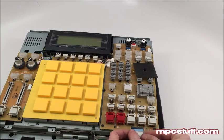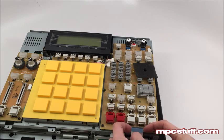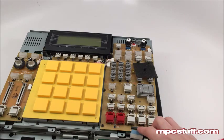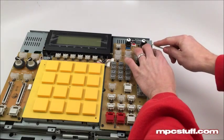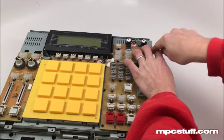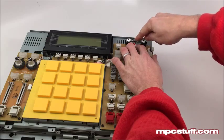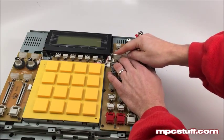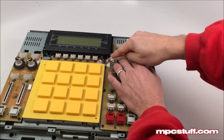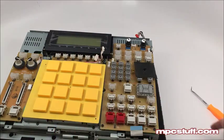For informational purposes, here's how to take it off. First, we're going to take our ribbon cables off. Depending on how old your unit is, some will just pull out like this one did, and some will have a clip that you need to pull down before pulling it out. The newer style just pulls out and pushes in, but the older style has a clip. Then go up here and release these white cables. A screwdriver works well — try not to pull the wires; you don't want to pull out the harness. We're just using a little pick here.